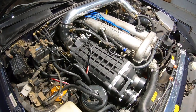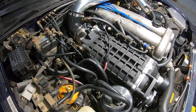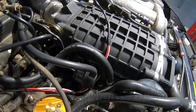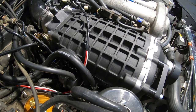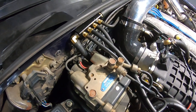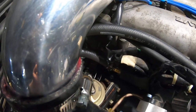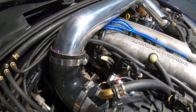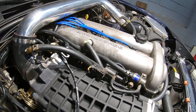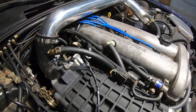We'll start over here on this side. So of course we've got the supercharger here, and the fuel system turned out pretty nice. It was looking a little bit chaotic at the beginning, but right here we've got our return line and our feed line, and those are just hooked into the factory hard lines that come with the car. So we've essentially extended those lines, and just for cleanliness, we actually ran them over around behind the ABS unit, so they come around to the back behind the intake. You can see right down in there is where the feed line hooks up to the rail, and that flows through the rail. This line here also comes off of the fuel rail to feed the fifth injector, and then we've got the fuel pressure regulator, which then runs the excess fuel through the return line back along that same path.